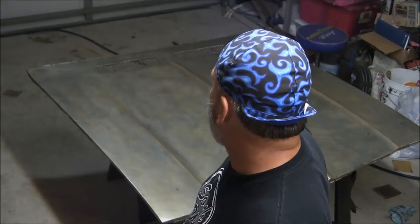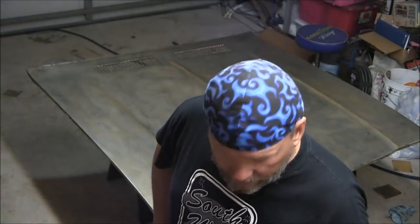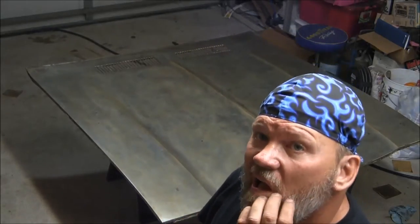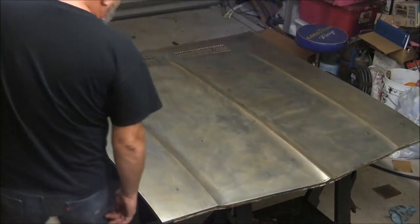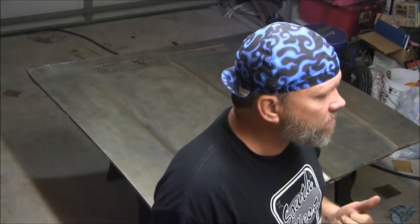After working all weekend on and off, I've got the top of the hood prepped. As you can see from the video earlier today, I did the vinegar and water 3-to-1 solution. The rust has turned a nice dark color and had a little bit of an orange haze on it. I'm going to wipe it off with paper towels, sort of like a tack cloth.